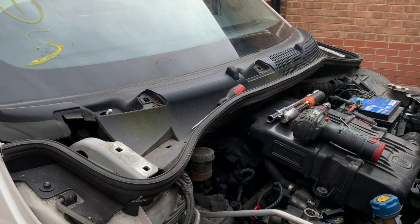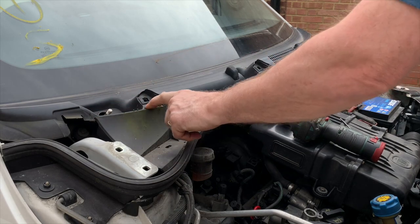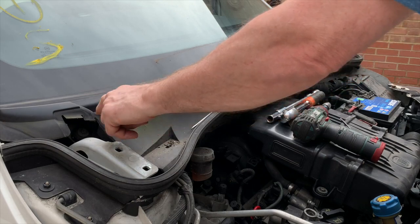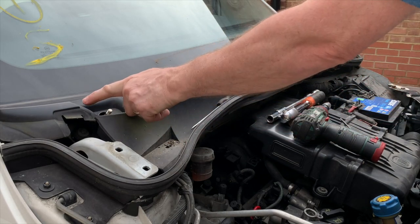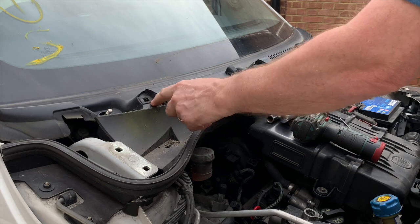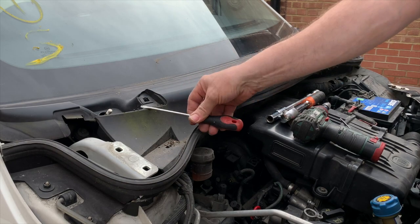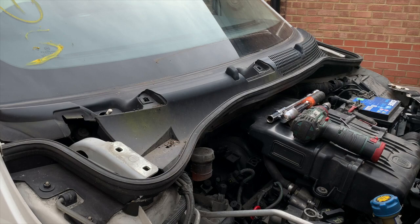Obviously what I forgot to mention was you've got these panels that normally cover the windscreen wipers. I had one missing and the other I took off the other day - unfortunately the bit inside was broken so it needs to be glued back together. They push in that side and then slot in and clip on that side. When you get them out, use a fairly big screwdriver or a blunt trim tool and prise it out - try not to break it. If you do break them, you can super glue the little tabs back on.